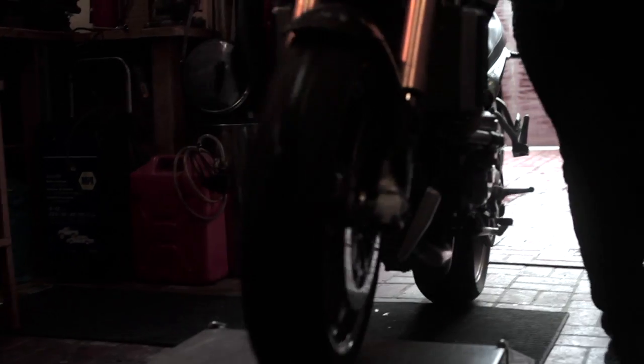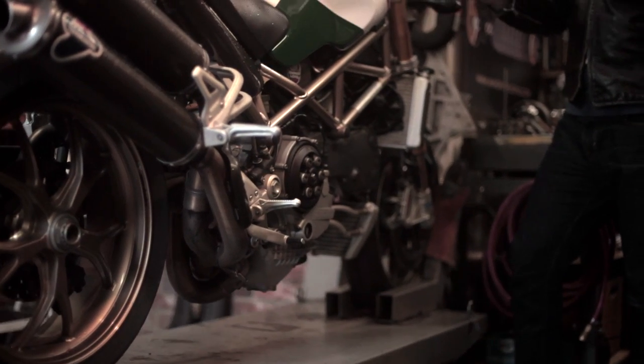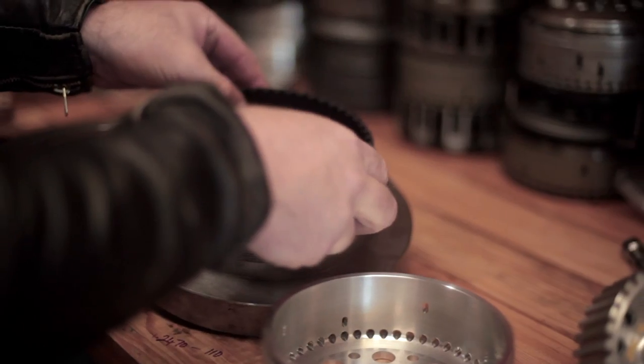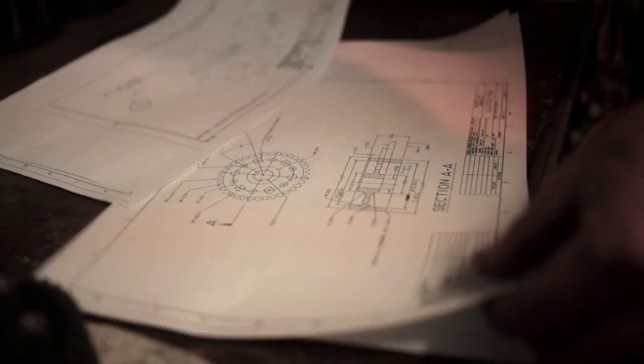And I asked the guy whether or not they'd closed up the tolerances on the plates and whether it was still loud and jangly. If you don't allow the plates to shake apart, you can't find neutrals and you can't change gears properly. It's an engineering conundrum. It became a challenge for me to figure out how to basically make a dry clutch perform as well as a wet clutch. First challenge was to stop the clattering of the basket.